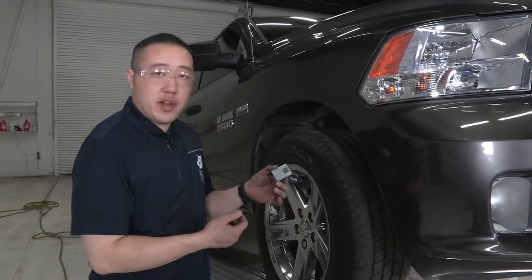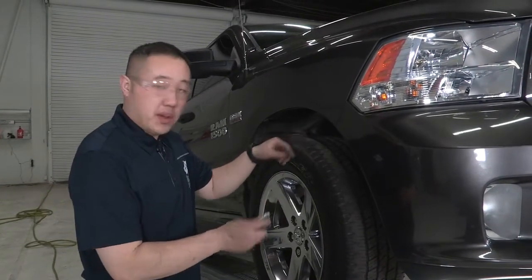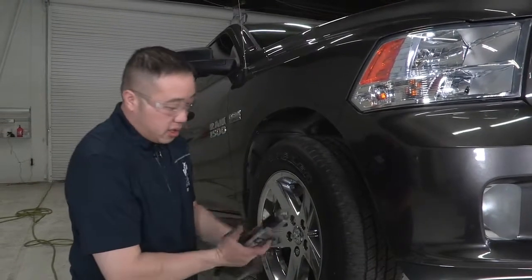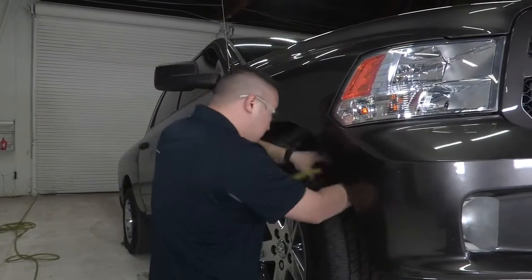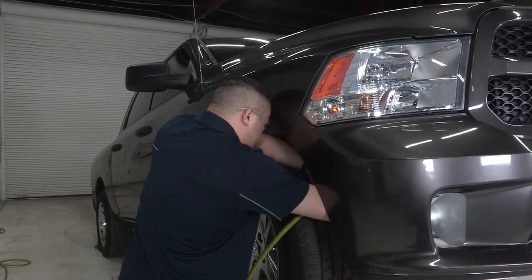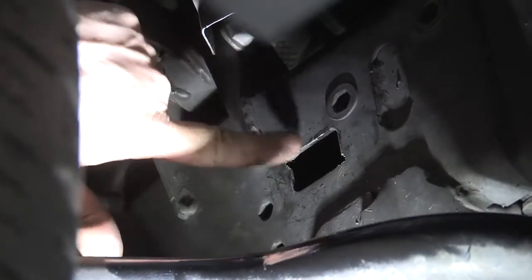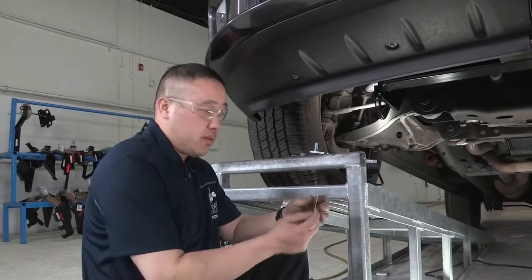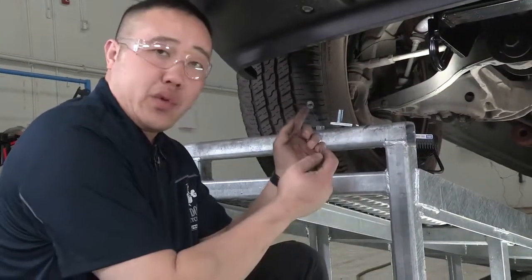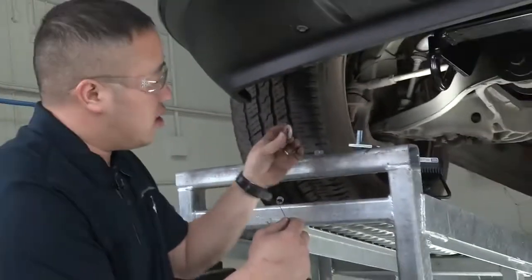Before we can fishwire our hardware into place, we notice that our plate here is just a little bit too big for the access hole, so we do have to notch out a little bit on the frame itself so we can get this plate to go in. We'll be using an air saw to notch out the sides on the hole there. The sides that we notched out are this corner here and this corner here, just to make the access hole a little bit larger diagonally so we can take our access plate and make sure it fits into the hole. Now that we have that hole large enough for our access plate to go through, we're going to take our fishwire, put it through the hole that we had drilled, go through that access hole where we enlarged. We'll be putting in our plate and our bolt, and then we'll pull it through, and we'll be able to put in our washer with the nut on it.